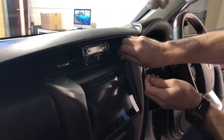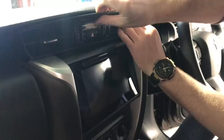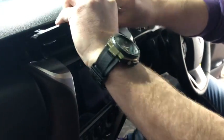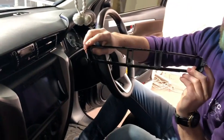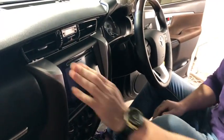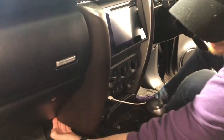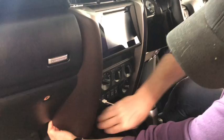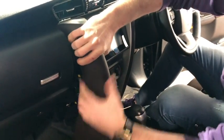Up the top here around these air vents, we're just going to pull these off. You can simply put your hand inside there and clip them forward — be a little bit gentle, they are a thin part, and they'll come off very easily because there's some clips on the side. From there, we're going to remove these two side silver panels. Put your hand down the back end of them, pull forward, and lift them up and they will clip out.